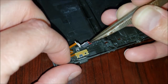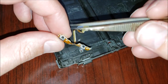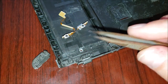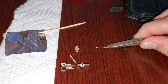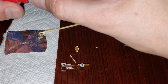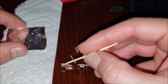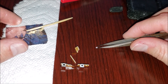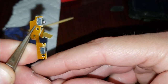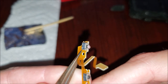I get the click! So my plan is to cut that metal piece to a size small enough that I can super glue it on top of this button. It's simply going to increase the height of the button and allow the shoulder trigger to depress it. Here is the metal piece now cut to size. I'm going to squeeze some super glue out on aluminum foil, grab a little bit on the end of a toothpick, and put it on the tip of the button. Pick that up and just set it on there — done. You can see we've increased the height of the button; that's six layers of pop can glued to the tip.